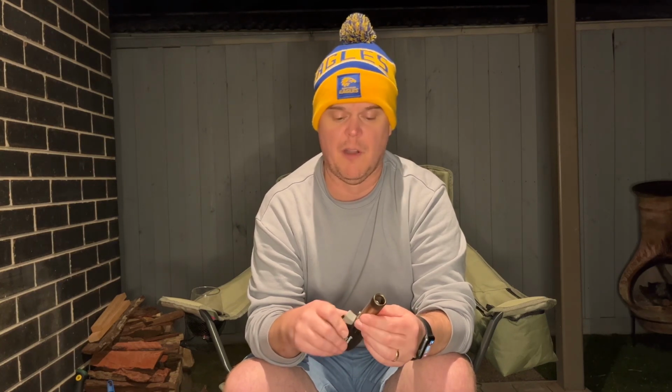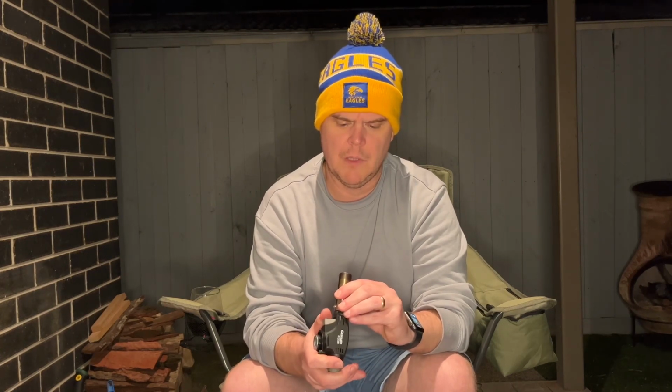Anyway, what was happening and what the reviews say on the Bunnings website is that the igniter fails, and that's fair dinkum. So I had to tickle up the igniter. There's a small little brass igniter in there, or it could be copper, I don't know. Well, I tickled it up with some sandpaper and the little file on my Leatherman, and now she's working top notch.